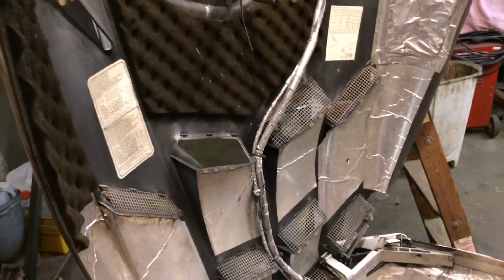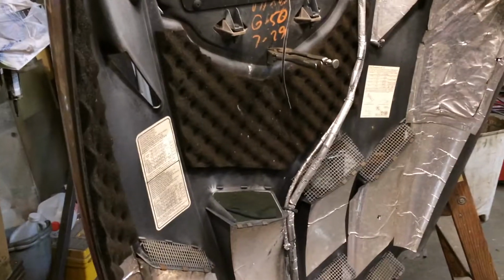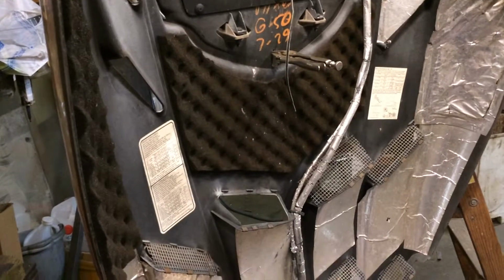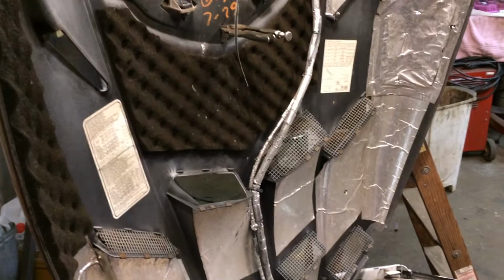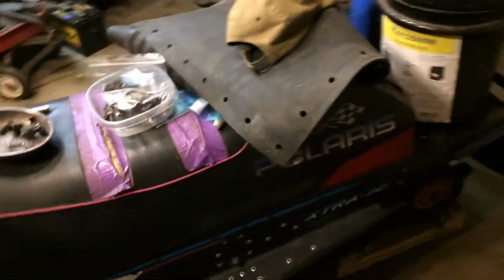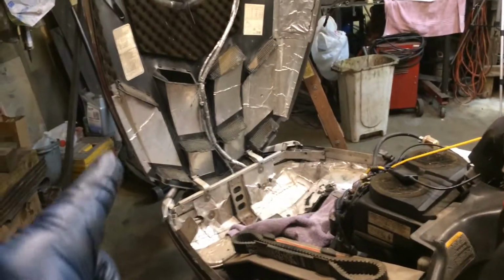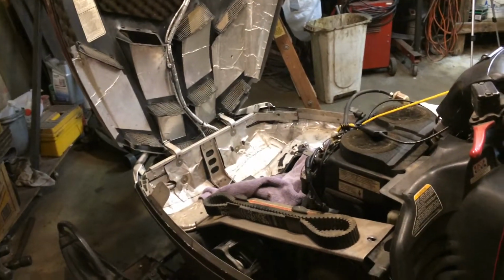Don't go buy yourself a set of drill bits and drill into those already micro fine, perfectly engineered jets that are in it already. Find the problem, figure out what altitude you're at, fix the problem that way. Like maybe some new jets. Certainly these vehicles have been used at 6,000 feet, and certainly they have been used at 500 feet. That's why there is a sign right there on the hood, and it tells you what to use.